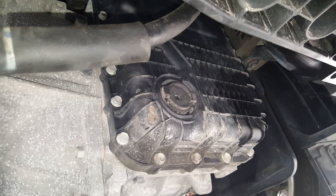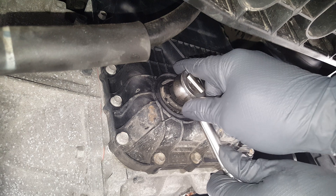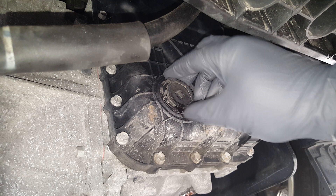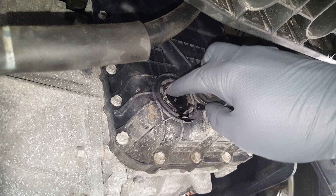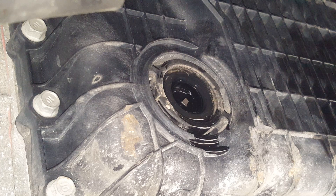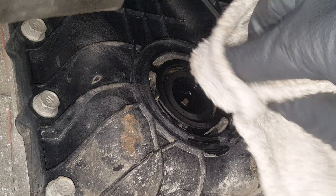So that's going to drizzle for a while. Just any ordinary 3/8 ratchet — we're going to turn this. It doesn't take a lot to turn it, just a little bit, and it'll pop right off. You basically turn it around until it stops. It'll only turn so far to the left — you loosen it like any bolt, but it's got a plastic stop on this side. So you just want to turn it to that point. Now the beauty of this, if you have the little pump — they're cheap, about $5 or $6 — this is actually where you check the transmission fluid.